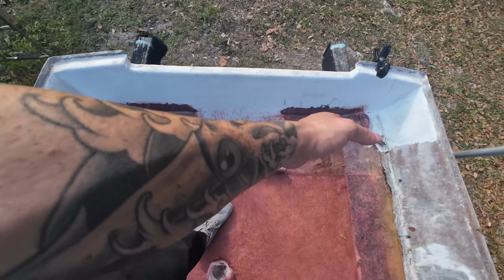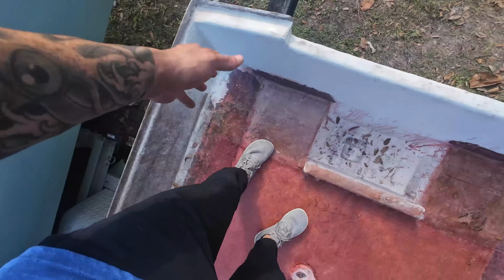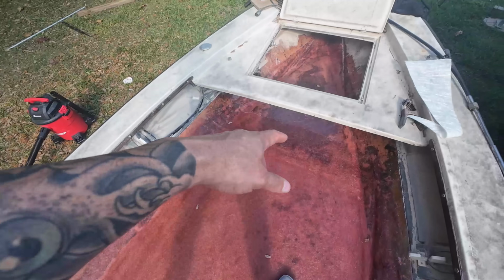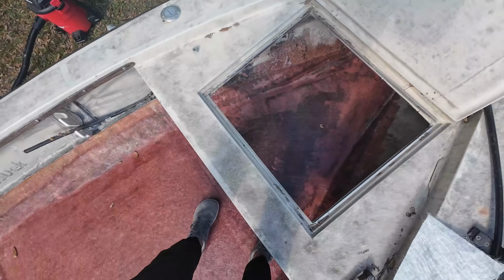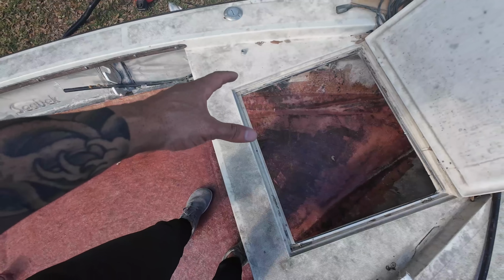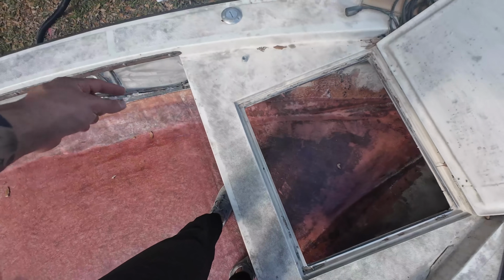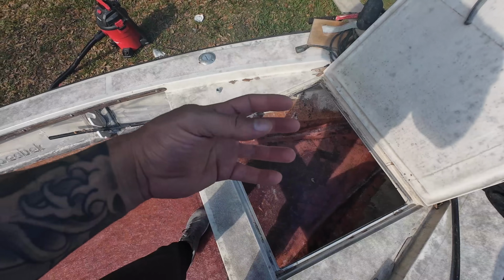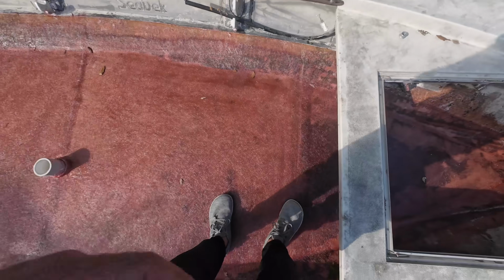Nothing's really going to go back here. Nothing that's going to screw into there. And that's what I had. I had some polyfoam board pieces there. And the reason why I chose K-Cell composite board up here was because the fuel tank goes up here, and that will get screwed down to the deck. And the K-Cell composite board has better screw retention than the Diab Divinycell does.